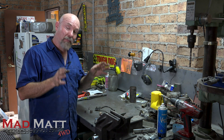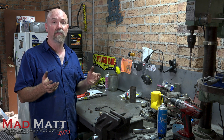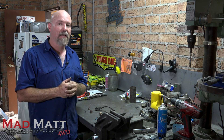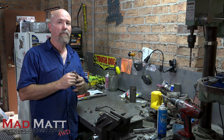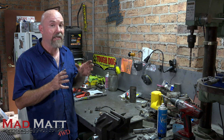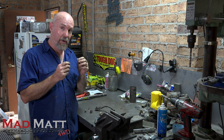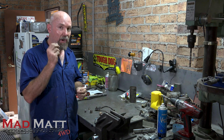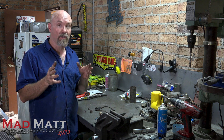Basically, what was happening was I was developing a miss in my 4WD. There were some other symptoms as well — a little bit of blue smoke on the overrun or when I'd been idling at the traffic lights. If you'd like to find out about that, go and watch part one. In this one, I really want to focus on the O2 sensors and how they played their part, because essentially they were getting contaminated and dirty and were no longer sending the correct information to the ECU, so the ECU couldn't do its job properly.